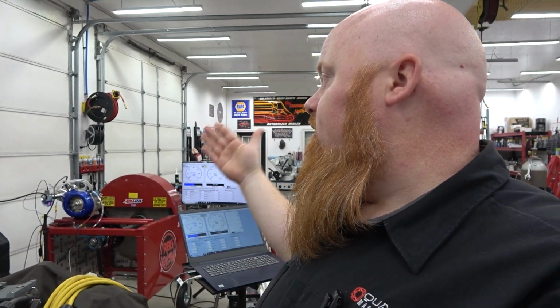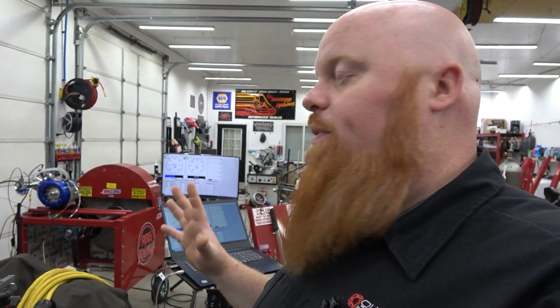We did have to run standard 212cc chromoly push rods. Now this head, they do say you want to run the quarter inch big block style push rods, but you have to put the small block ends in it. And I didn't have any of the ends. So we just used standard 212cc chromoly push rods. I think they're 3/16 in diameter. So we're hoping that does fine with almost 460 lift because we're running that 356 cam.